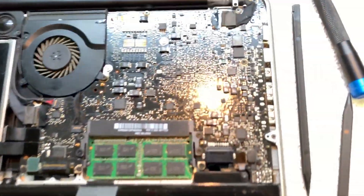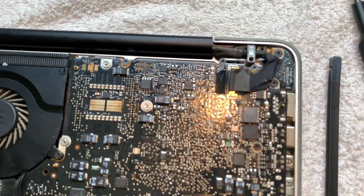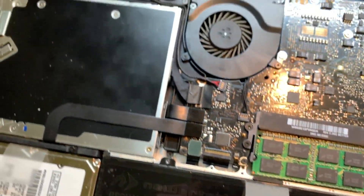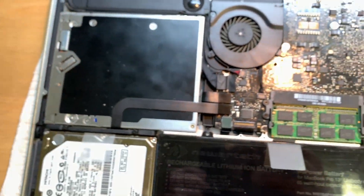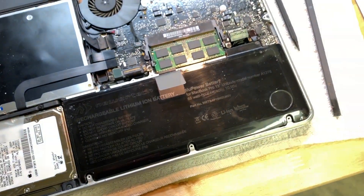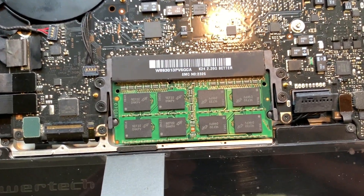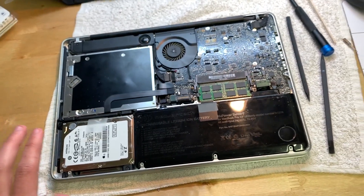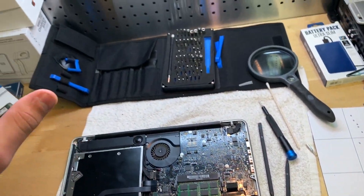Also make sure you have RAM installed, or it probably won't boot at all. If it's still not booting, make sure all your connections are good, plug it in, and make sure the battery is connected. For part two, I'll go ahead and replace the RAM module. If you want to see that, click on the next video in this series.